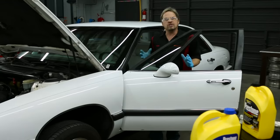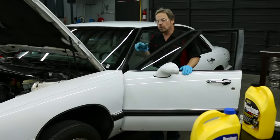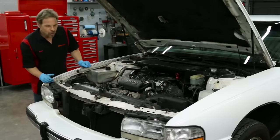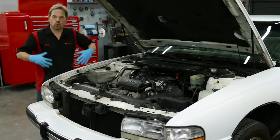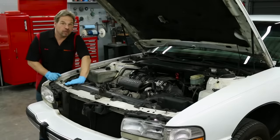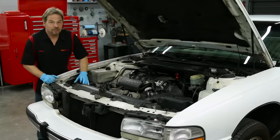Keep in mind, do this in a well-ventilated area with the garage door open, or if you're doing it with the door closed, route the exhaust outside the building. We let the car run until it got good and warm and had a chance to run everything through the cooling system. Then we shut it off and let it cool down for about 15 minutes. Now we're going to repeat the flushing process.